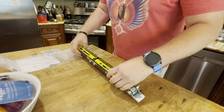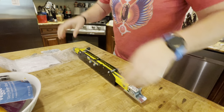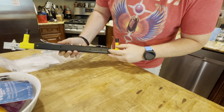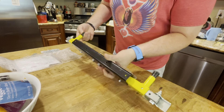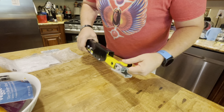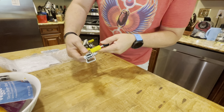So this is the Solid Stance. It mounts up against the bottom of the step. There are four bolt holes — one, two, three, four — and it mounts to the bottom side of the step. These spring arm plungers — I don't know the technical term, but it's like a solid step: it lengthens the step out. For unlevel ground you can adjust the length of the step. There are two pins you can pull out with spring balls, which allows your step to be adjusted in height. Certainly feels pretty sturdy. I'm excited to see how well it holds up to the rigors of camping.